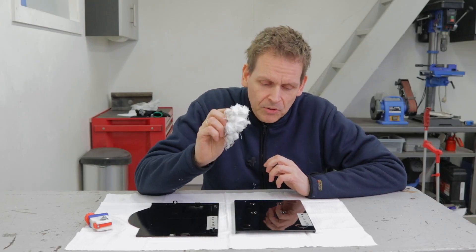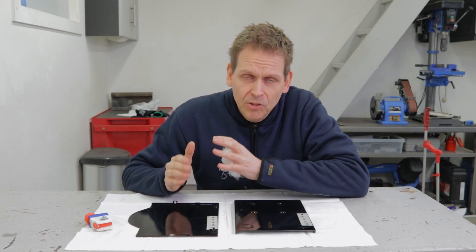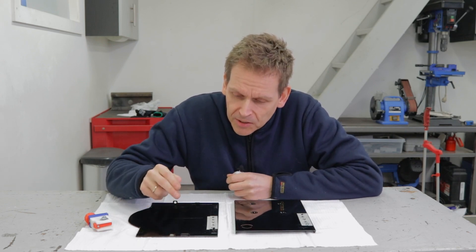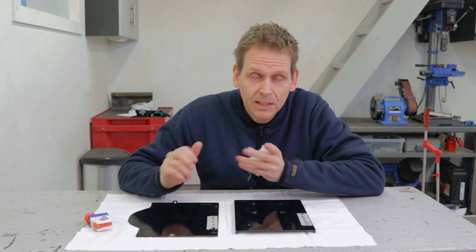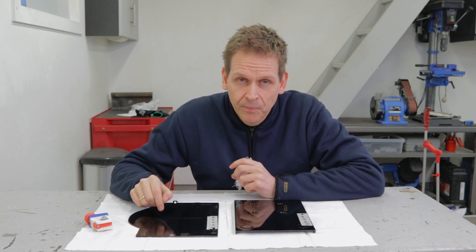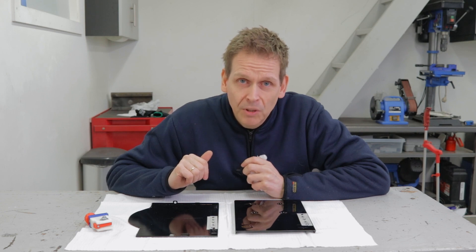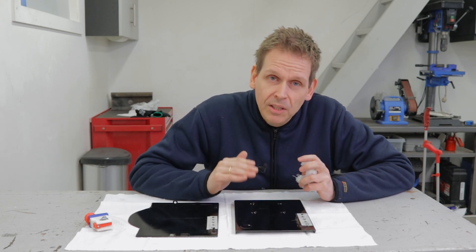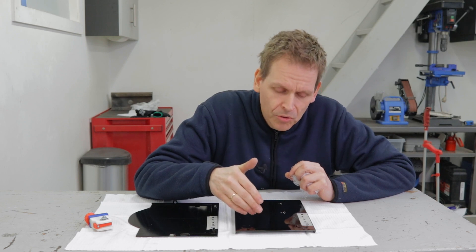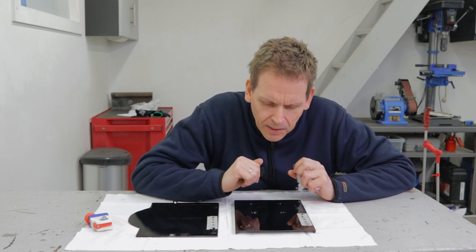I went over with a small amount of polish to remove debris and make the scratch easier to see. The result is a bit surprising - it seems like the spray can paint is both harder and weaker. On levels 0, 2, 4 and 6, I can see no visible scratches on the spray can - it's like it hasn't scratched at all, maybe barely on 6. But on level 8, it seems to go straight through to the metal - a very hard surface, but when you first break it, it does a lot of damage. While on the Glasurit car paint, it has gradually made scratches - barely visible at level 2, but on 4, 6 and 8 the scratches are deeper and deeper, though they haven't gone that deep into the paint.